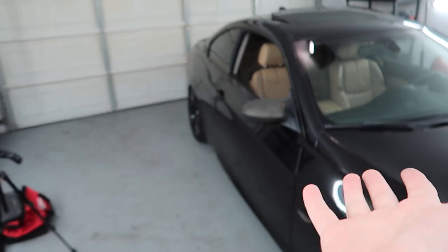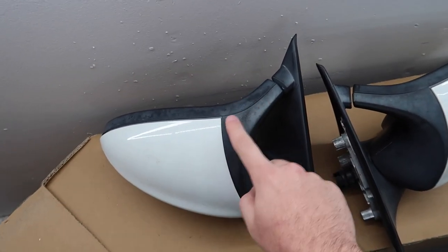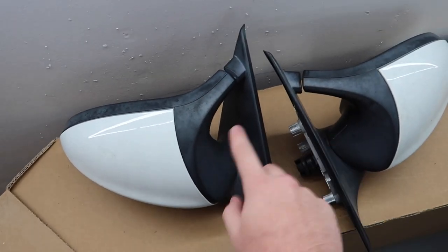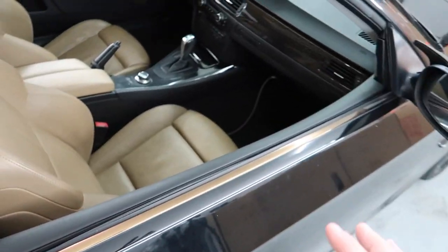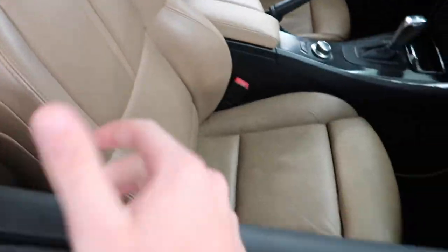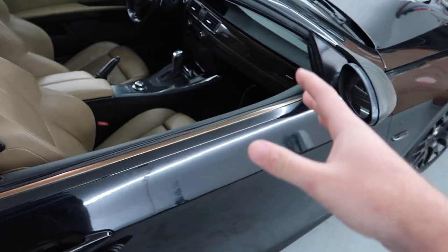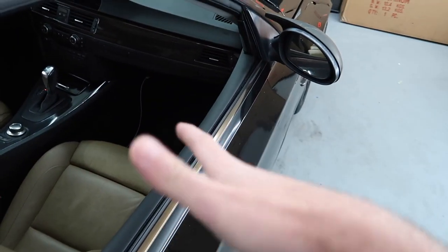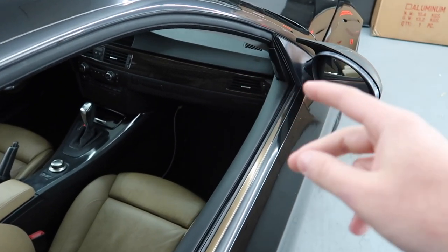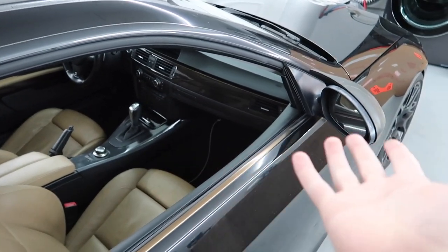Once we slap these on, I'm going to wrap them in gloss black and use some plastic shine product to bring them out. Also in this video, I want to fix a speaker issue - after putting together the door panels, one speaker works on each side but not the other. It might be a different sound system in these door panels causing issues, or I might just need to flip the wires.